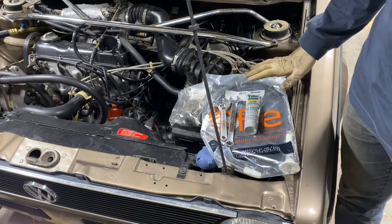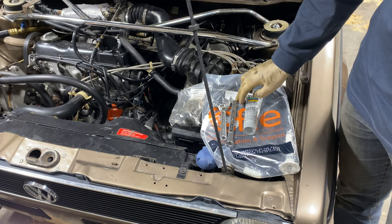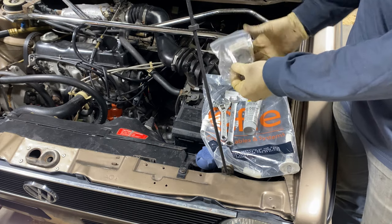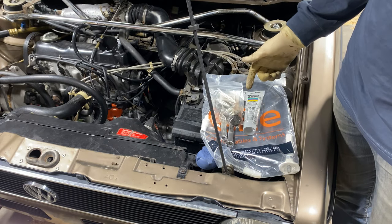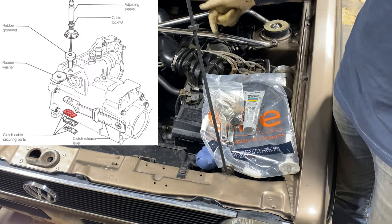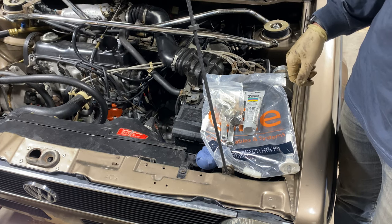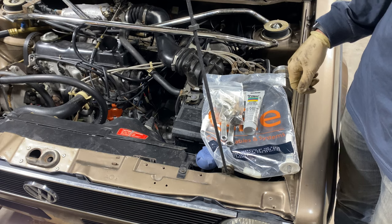Tools and parts for this repair are rather straightforward: just some grease, a 13 millimeter socket, an adjustable wrench, a clutch cable obviously, and then some rubber components. There are some rubber components not pictured here, and as you've seen in the picture they are between where the clutch cable mounts to the transmission lever. As always I will include part numbers in the description and some links as well.